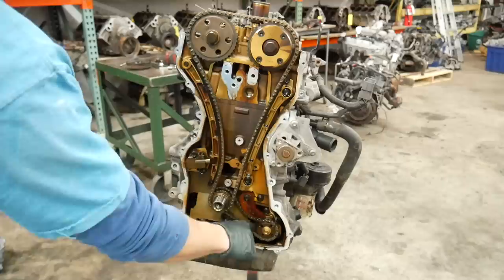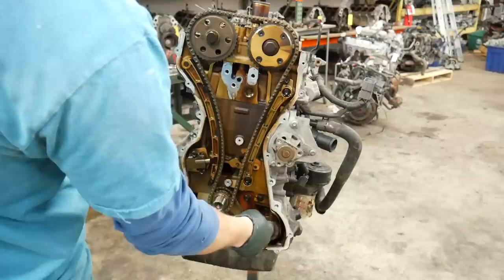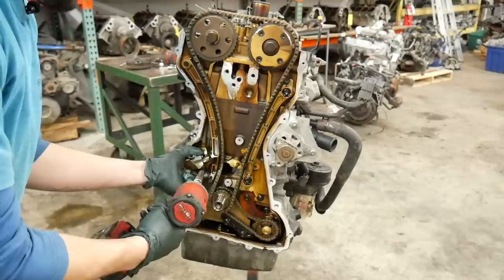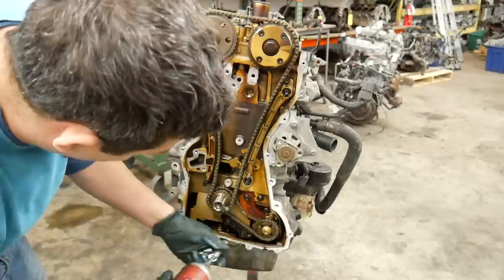At this point I'm going to go ahead and tear the chain off. Trying to get the oil pump chain loose — sometimes that can fight me, sometimes I've had to hammer these and shatter them. I don't really recommend using used pumps on these things; they're not that expensive new. Same with all the timing components: never, ever use used timing components on these engines.